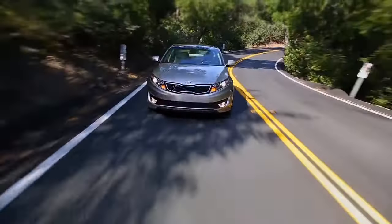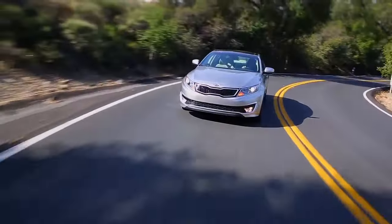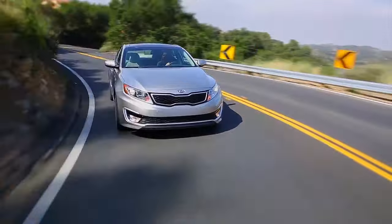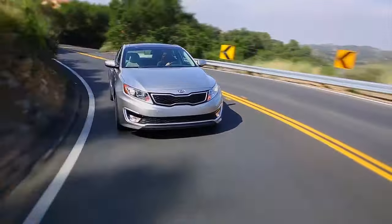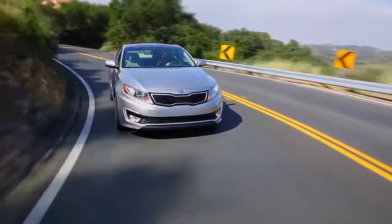After ensuring the tire is properly sealed, you can drive cautiously on the tire up to 200 kilometers, remembering not to exceed 80 kilometers per hour. It is recommended to visit the nearest Kia dealer to have the tire repaired or replaced as soon as possible. Don't forget to replace the sealant canister as well. Systems may vary from vehicle to vehicle — please refer to the owner's manual or consult your local Kia dealer for more information on this feature.